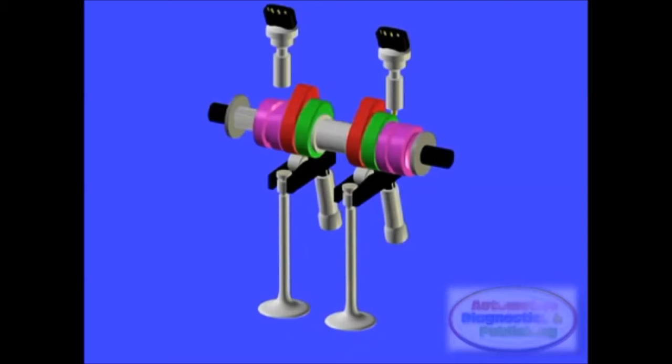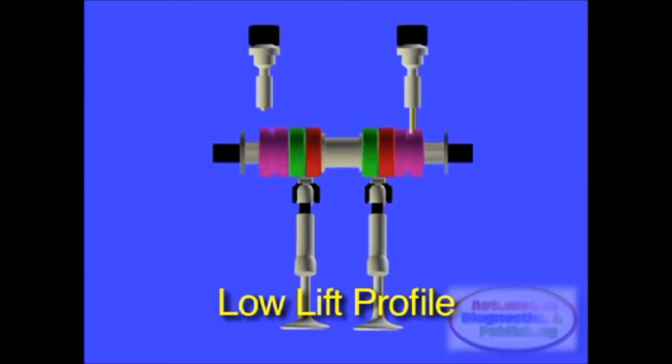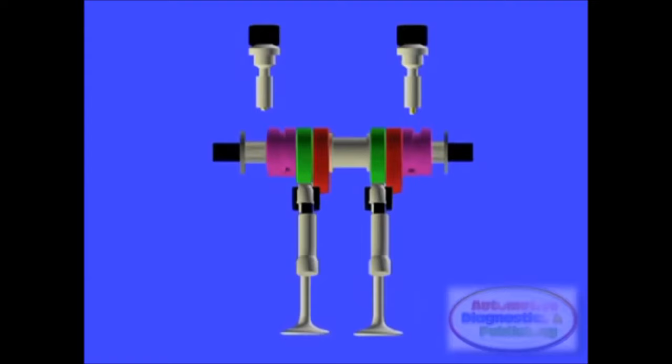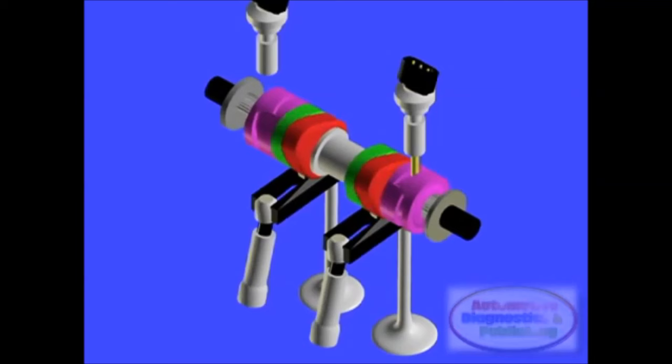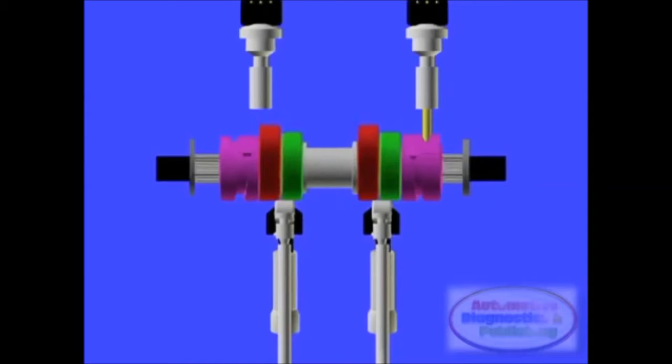Each valve can be actuated by a fast cam at 1/2 inch, or a slow cam at 1/4 inch in the intake valve, and 1/16 inch in the other valve, so as to create swirl in the airflow for better fuel atomization at low speed. The two cams are mounted on a single camshaft piece, which acts on the roller cam follower, depending on the longitudinal position of the cam piece.